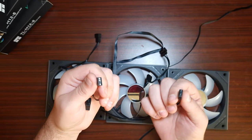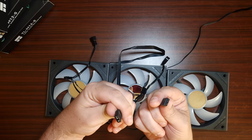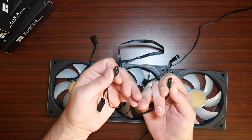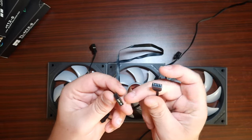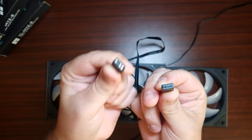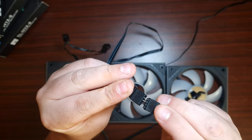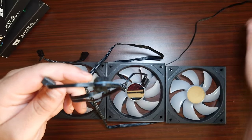If you try overloading it, it will and can damage something. Or what it will do is the last fan in the signal connection will start flickering or might even not work. But this is how you connect it — just like this, three pin. There is the female, that's the male. You put it there and you've synced up these two fans with the ARGB.